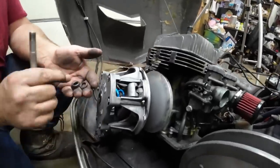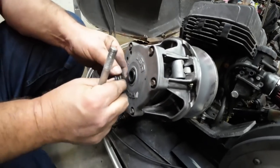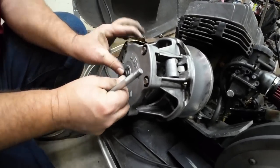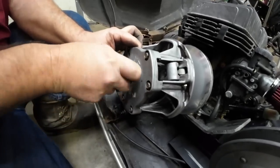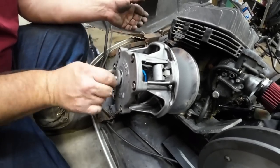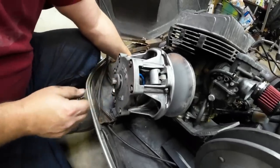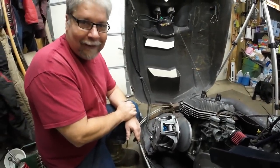And then to keep the sleeve from bouncing around in there, we've got these big fat O-rings. You just put them in and it should be just a little proud like that. So that we got like a half a diameter of an O-ring out that hole. And that's it. We got plenty of thread engagement. I couldn't find a top hat, but that's fine. We don't need a top hat. And that's that. We're just going to lock her down and give her a test run.